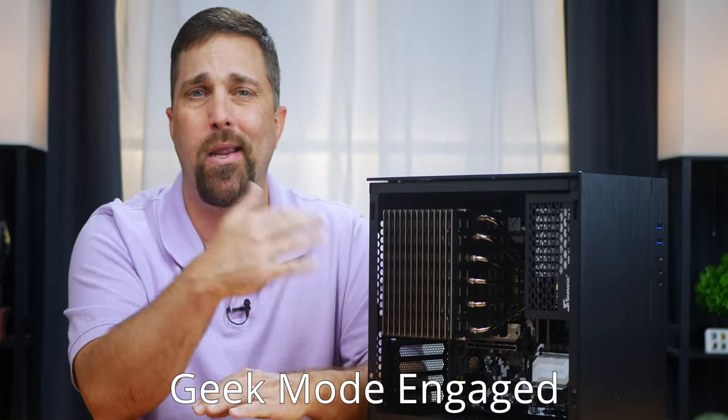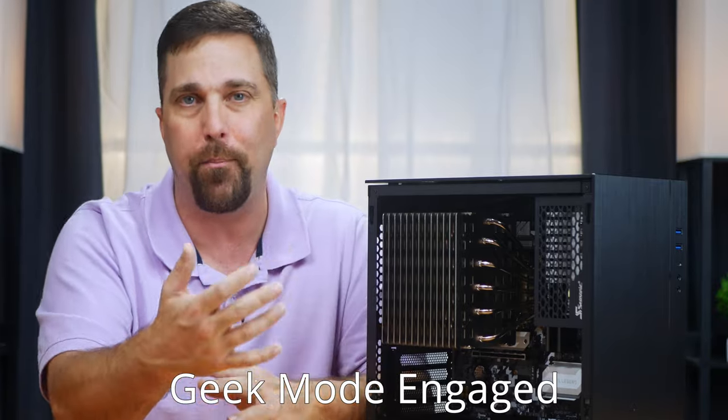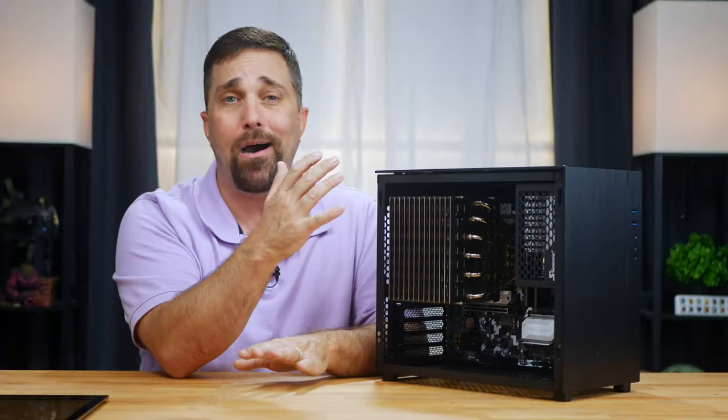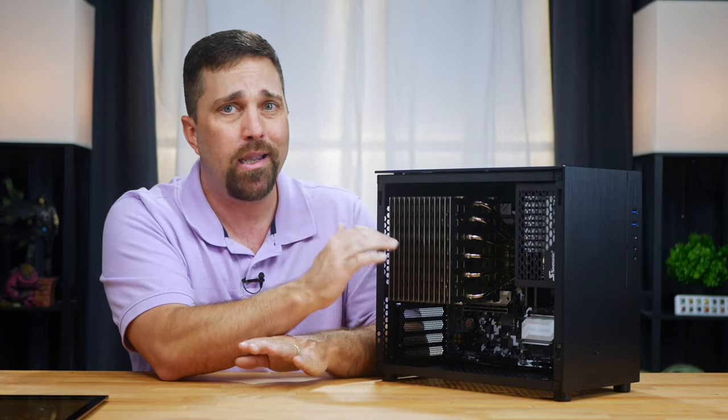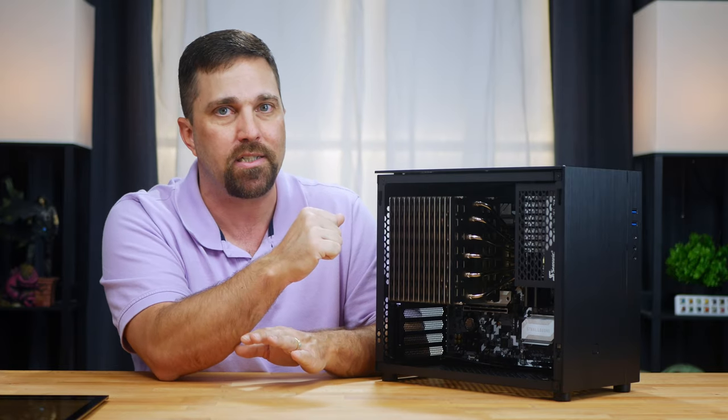And in my experience, at stock settings, no overclock, if it's stable after an hour, it's not gonna throw errors until you get to the 72 hours or more period, where your non-ECC memory can start flipping bits and you encounter P95 rounding errors. But that doesn't have anything to do with heat. And a modern Intel CPU can operate pretty much indefinitely at 83 degrees Celsius.